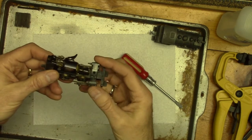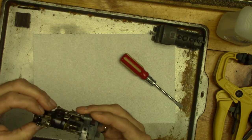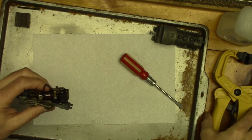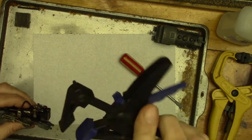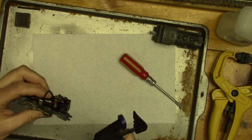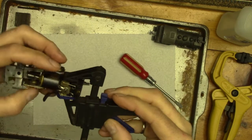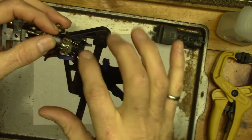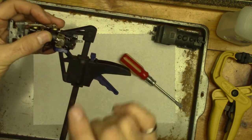I want to be careful with the oscillating parts — they come apart and they're a little fiddly, so I'm going to try not to take those apart today. Here's where the clamp is going to come in. This one clamp is just too big, so I need a smaller one. The reason is when I take this screw out, these contacts are both springs and boy do they spring. So if we're not holding that with a clamp when I take that screw out, there will be parts everywhere. We're going to be careful and put the clamp on there before I take the screw out.